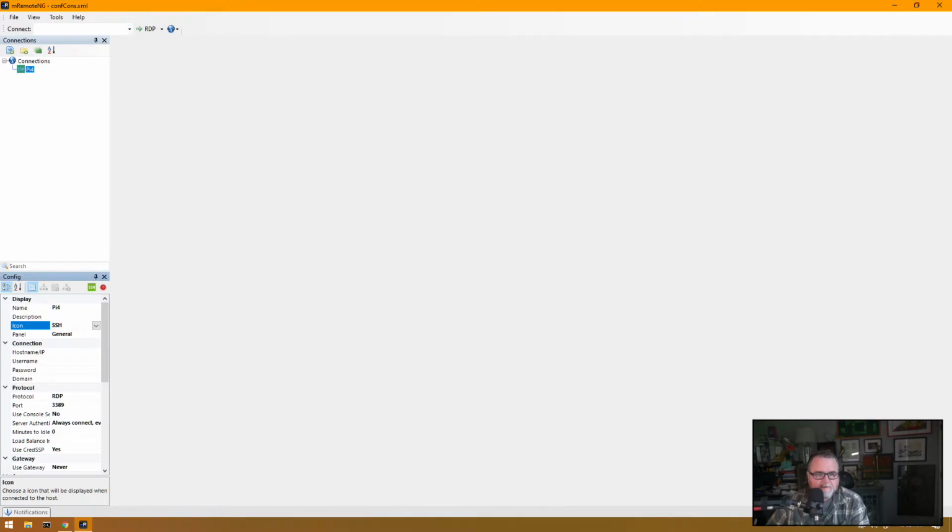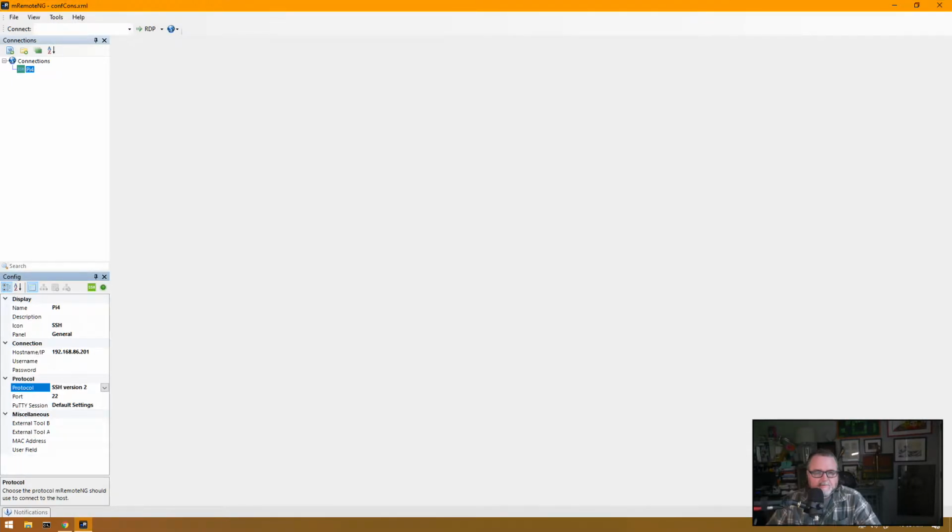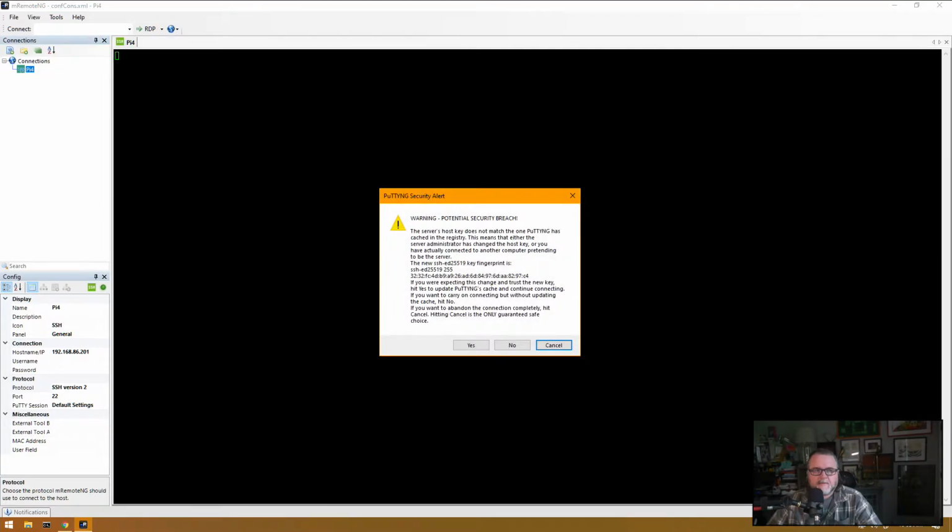General panel's good. Now we need our host name or IP, and in my case it's going to be 192.168.86.201. Remember from the last video, I set the static IP as this. Username and password, we're going to come back to in a minute. Protocol, we want to set SSH version 2, and that should be it for now.